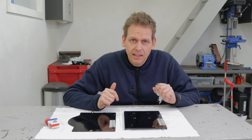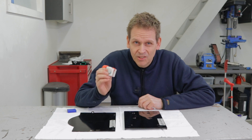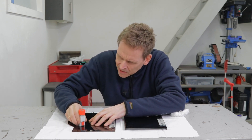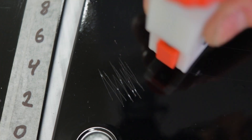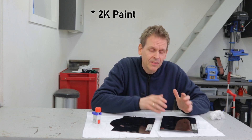This isn't that scientific a test, so maybe I'll do a proper stress test. I'm at level 7 - let's really scuff this up. Spray can... 2K paint... Let me try at higher levels. As you can see, almost no impact on the 2K paint. This makes it quite hard to conclude. At least the spray can paint isn't as bad as I thought - it holds up pretty well, and in some circumstances it's even harder than the car paint. But when you really apply a lot of force, then the car paint seems to be more durable - but it's probably also thicker.